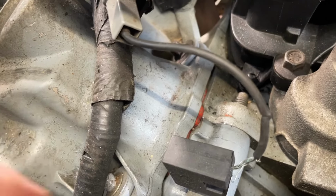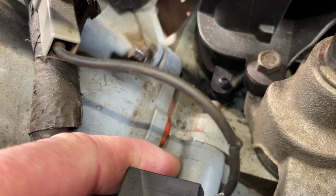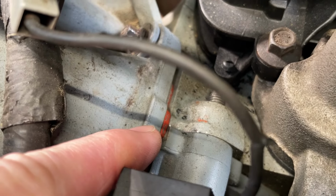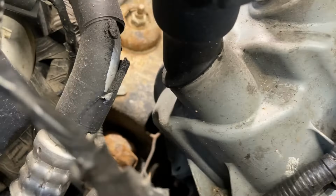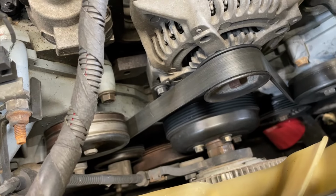It's not so bad. And they also missed the sealant glob on the joint between the front cover and the head. You see there's no sealant glob there? So, of course, it's leaking oil. And, of course, that means the other side is missing the sealant glob, and that's the one that really leaks oil. So did they miss the sealant glob on the T-joints and the front cover too? I don't know. The coolant on here is almost empty, and it's also the wrong color for this year.